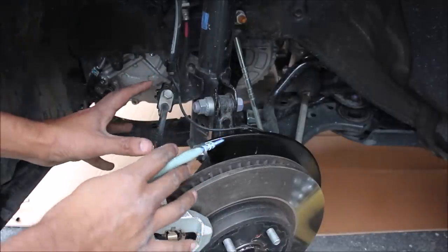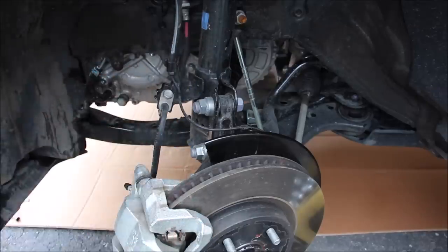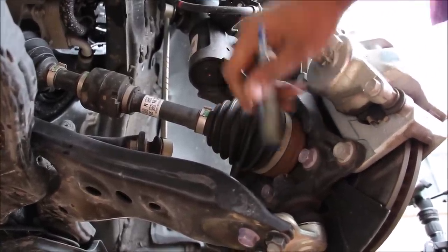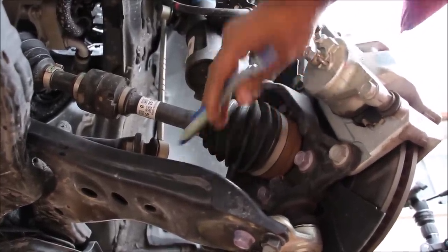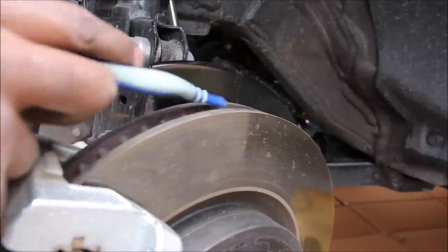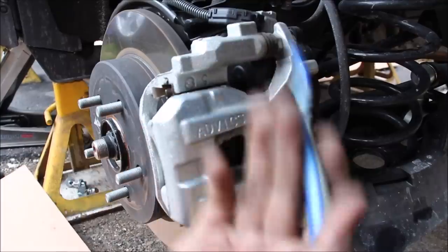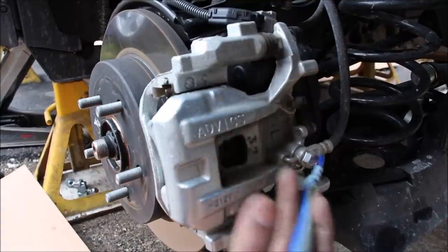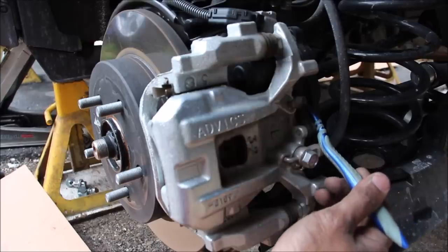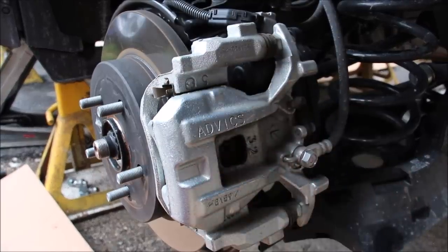Having a McPherson suspension is beneficial because come maintenance time there aren't too many parts that will wear out, and when they do it's pretty easy to work on. The front here has steel knuckles with a bolt-on style hub, which means you don't need a press to change the bearing. We have a standard style CV boot and the brakes are just a single piston sliding caliper style. Upgrading the brakes shouldn't be too difficult because the disc rotor is actually slightly smaller than the dust shield, giving you enough room to put a bigger rotor on. The rear brakes on the RAV4 are also just a single piston caliper, but it has an electronic parking brake actuator at the back that actuates the brake pads to clamp down on the disc when you put the vehicle in park.